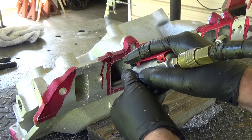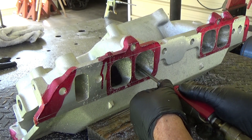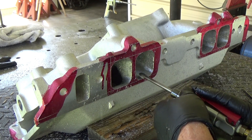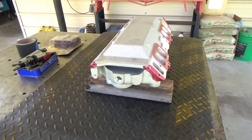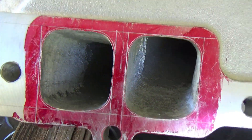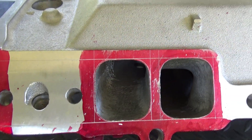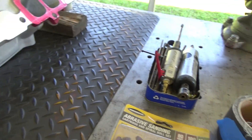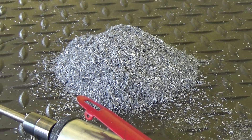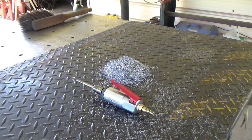Now I'm going to do the floor and blend it in, giving it a nice easy curve going in. The dual plane intake is basically two different intakes with the lower and upper parts, so they're never going to flow exactly the same. But here's what the majority of the material removed from the intake looks like. On the next video we'll be using the sand rolls to perfect the intake ports, making them even smoother and more contoured.